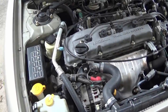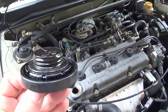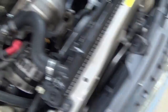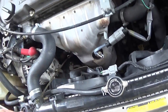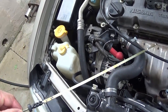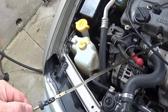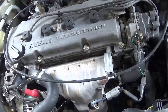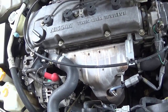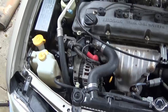To give you a reference point, here's a good car - pull the cap off and you see it's covered with oil, and that's the way it should look. Same with the dipstick too - nice shiny clean metal, oil down in the stick, not tan colored and burnt looking. This car gets the oil changed regularly. I've seen some where the dipstick looks black, but as long as it's got oil film on it you're doing okay.